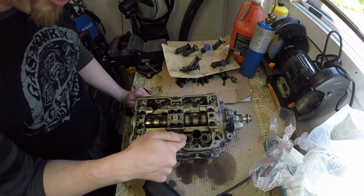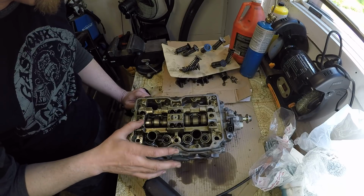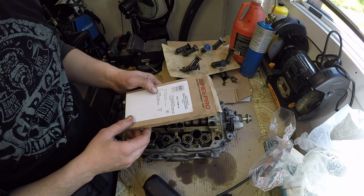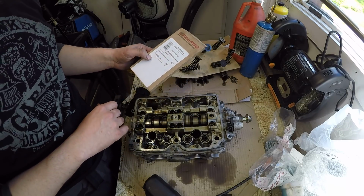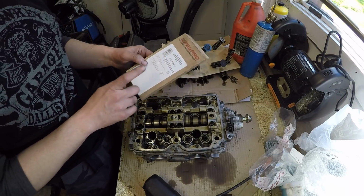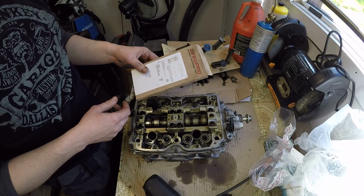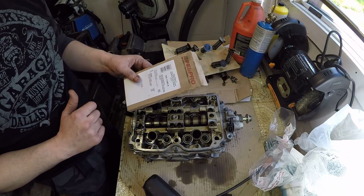So I was going to go about pulling out all the valve stem seals because I bought a set to replace them, but I'm looking at the box and I open them up and I realize there's just 16 of them in there, and then I read and it says valve stem seal exhaust, and I remember these being different colors, intake to exhaust, even though these ones measure up to be, they'll go right onto the intake valves and they feel really good. I can't come up with a Felpro number for the intake seals.